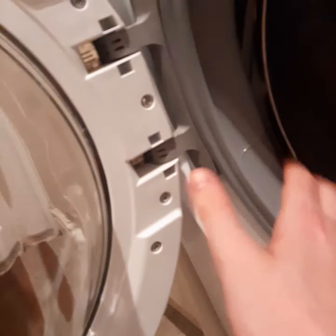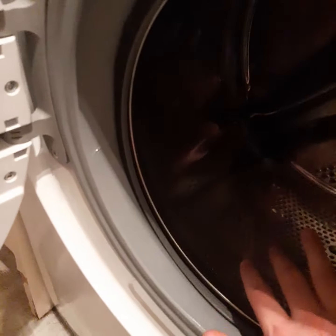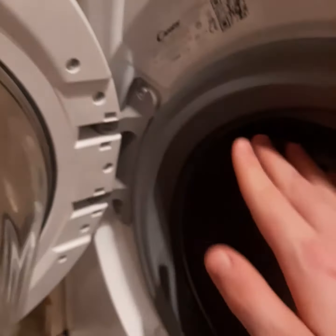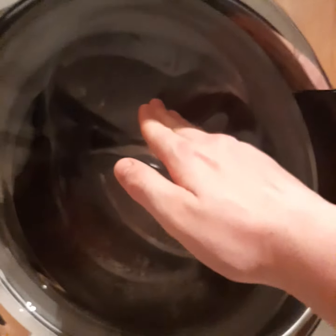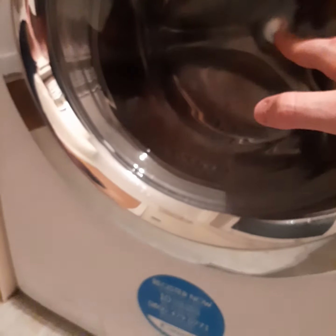Oh, and also, this little fill spout, which means from the drawer that it fills down the front, if it foams up, which it does quite a bit because of its washing action, it also means that foam starts coming out of the drawer. And the most annoying that I've seen it was about halfway. So, around about here. And normally it gets up to about here before anything starts coming out of the drawer. And it wasn't the type of detergent I was using, because I use the same amount for towels every time. It was just that one specific time.